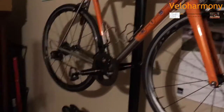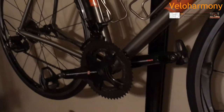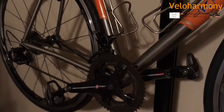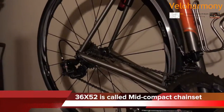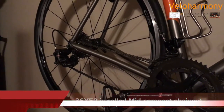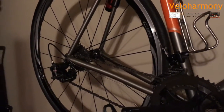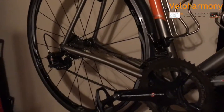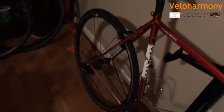On this bike I put a 36/52 chainring because I needed a bike that would have a smaller ratio for the real steep eight to nine percent climbs we have out west. The rest of them have a 39/53. In the back I usually run a 12-27. This is a Shimano wheel so it has a 12-28. The Shimano cassette works with a Campy chain and drivetrain — no problem, 11-speed, it just works. The Campys have a 12-27.